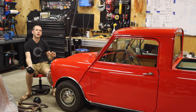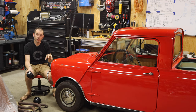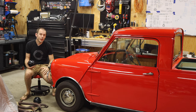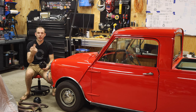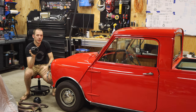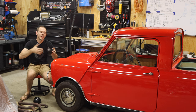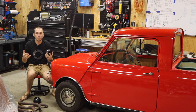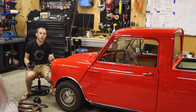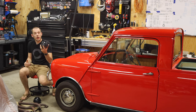On today's episode we're going to be tackling something that needs to be done on a lot of Minis that have been around for a while. So let's talk about the Classic Mini suspension — it's a bit unusual. For those of you who haven't worked on yours yet, it has some unique characteristics that set it apart from modern cars. Namely, instead of a standard traditional metal coil spring, it uses something called a suspension cone. These cones are made out of rubber, and over the years rubber degrades, gets compressed, and gets stuck in that compressed state, which ultimately makes the ride pretty miserable. The ride in this car is starting to get rigid and uncomfortable — a little more bouncy than a Classic Mini should be. That is where new cones come in.